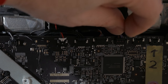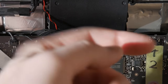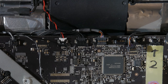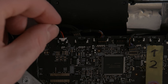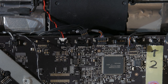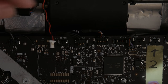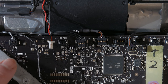Then we have to take out this one — pin side towards you — which comes out of this deep hole. It says 'BT' up there. This one, pin side towards you, says 'camera,' so the camera is up higher there. Then we take out the one that says 'HDD fan' — hard disk drive fan — these are a set of four black wires, whereas the other connectors have different colored wires. This white connector says 'HDD temperature,' which you can follow up to that temperature sensor.